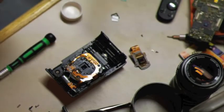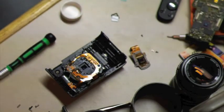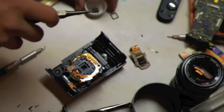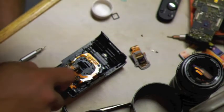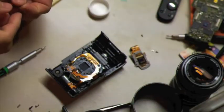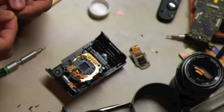I cut my piece of slide film out of this medium format 645 slide film. You can see there are black bars in between the pictures — I just used one of those and cut a little square out of it, the same size as the sensor. I wiped it on both sides with rubbing alcohol between my microfiber towel and then wiped it off. Then you set that little square into the camera body. This is the little rubber gasket that was between the sensor and the IR cut filter before, so that will go back in here too.